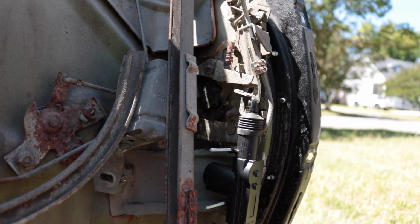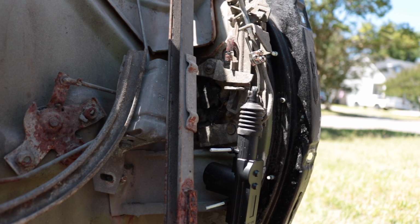This is the point though where you may notice you have issues with your lock motor actually being strong enough to unlock your doors. Kind of a normal problem with classic cars, usually taken care of with lubricating the door lock mechanism, but as you can see on this car, it's not guaranteed to actually work every time. But I got a couple different solutions for you. On your keyless entry remote start system, there should be an option for a double pulse lock output. So when you press your key once, it actually ends up pressing it twice, like that. Easy way to take care of it, but sometimes it's still not enough.